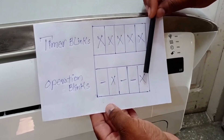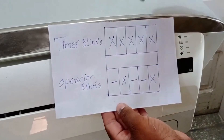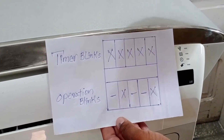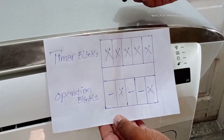This creates a combination code which helps identify the fault. In this case, the error indicates that after servicing or repairing the unit, the thermistors — sensors — have been connected incorrectly. You need to check and verify which sensor has been placed in the wrong position to correct the issue.